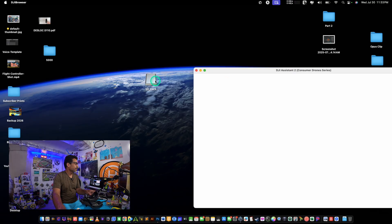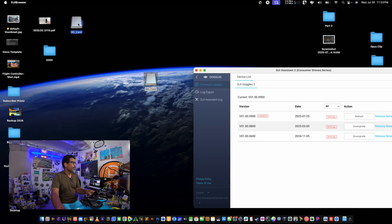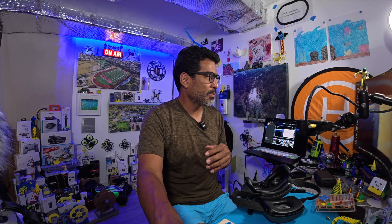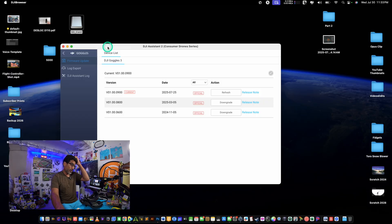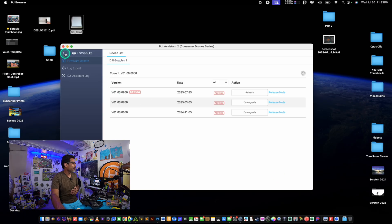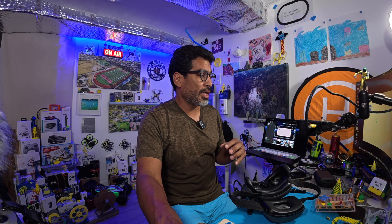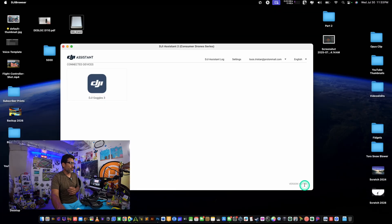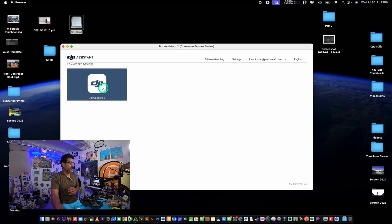And there's my SD card! I don't know why this happens — it was working before, I'd plug it in and out and work the magic that way, but then I figured out another way. As you can see, you can update it. Always make sure your app is current too, because sometimes if your DJI Assistant for consumer drones is not the latest version, the experience is flawed. You'll see 2.136 is the latest.